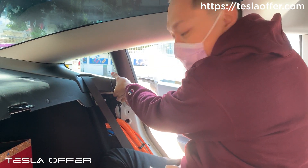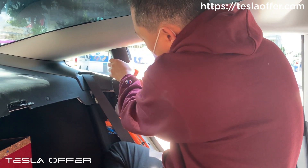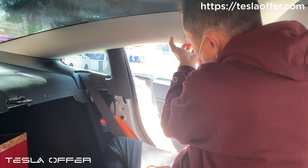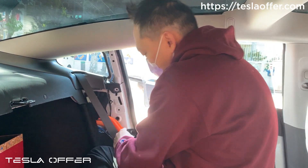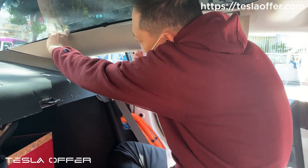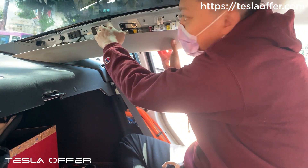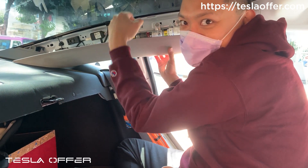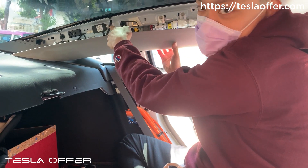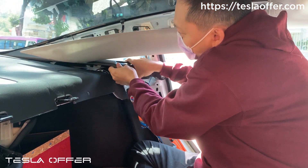For this piece, use your hand to pull it out — it's held by two clips. But you need to remove this first; pull it out and this will fall out. After you remove this, pull it out. Be careful — there is an antenna here. If you break this, you will need the whole glass replaced. Normally you won't be touching this one, but just be careful. After removing this one, slide this piece out and pull it out from here.